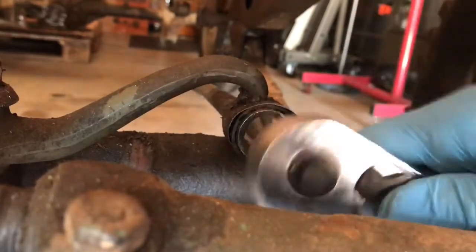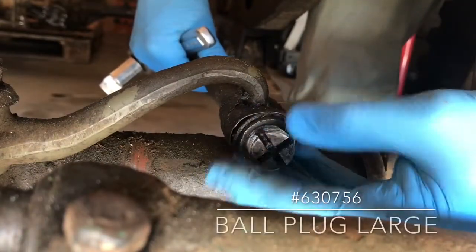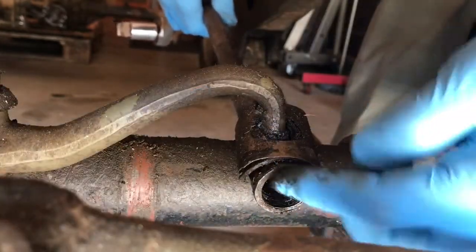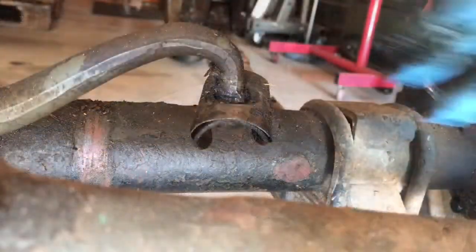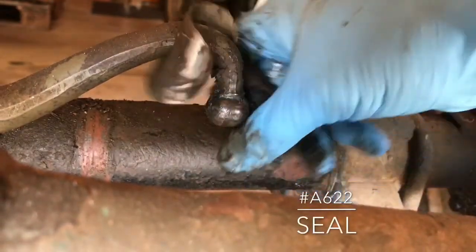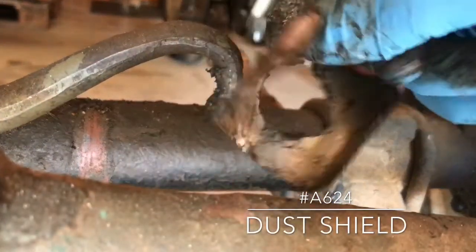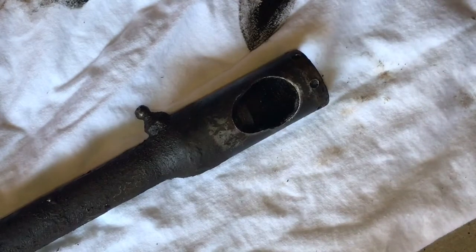I will go ahead and remove the large ball plug. There are some internal parts inside, but this is removed now so I can easily remove it from the ball on the bell crank, simply by pushing down on it. Then I remove the rubber seal and the dust shield from the ball. This is the bell crank side of the drag link and I have removed the actual ball plug from the end.